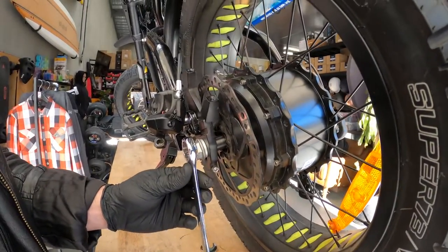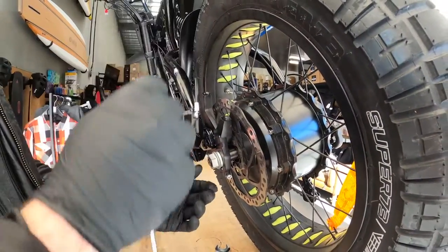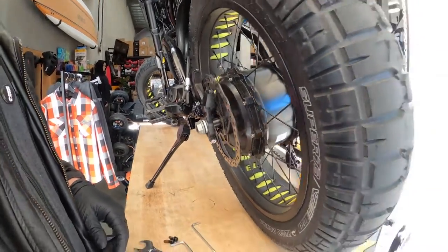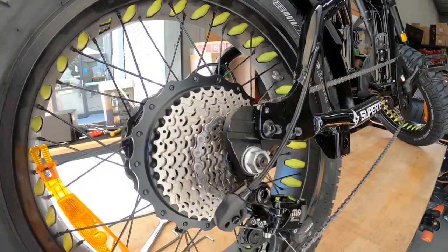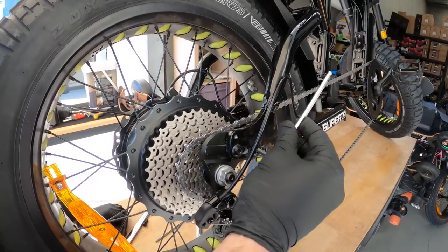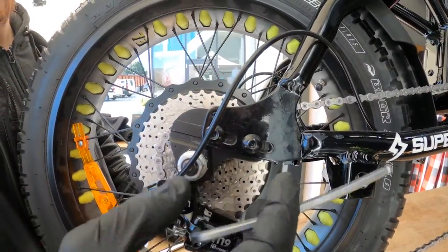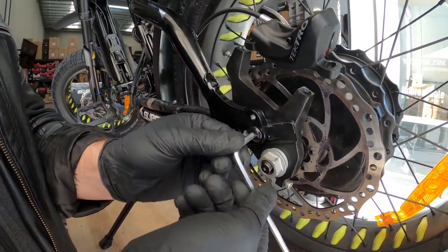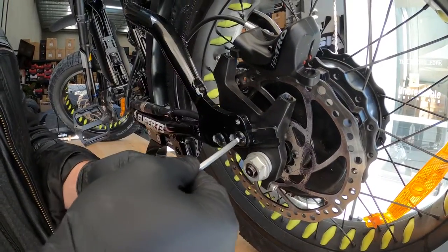The next step is to use the 21mm sized wrench or spanner to loosen the hub bolts — the other side will be an 18mm next to the derailleur. Don't take them off fully yet, just loosen them slightly so it is easier to spin. The third step is to loosen the four bolts holding in the wheel plates with a size 5 Allen key. Please do be careful when doing this — you don't want to accidentally pull on the derailleur line or the brake line.